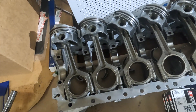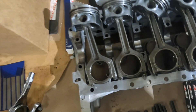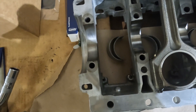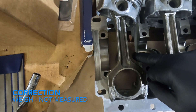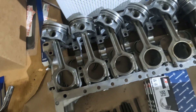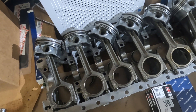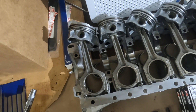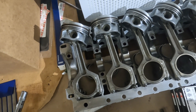We've got all the rings installed, all side clearances checked on all rings to be within BMW acceptable specifications. What I've done is measured each piston with the rod, piston, rings, and connecting rod bearings together to get the grams of weight. You've got to be within a certain grams of acceptable weight within each piston — the spec is within five grams. These were within three grams as a set, so each rod, piston, rings, and connecting rod bearings on all six were within three grams of each other.